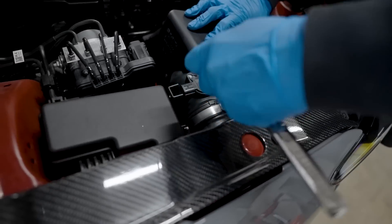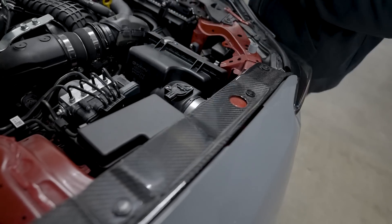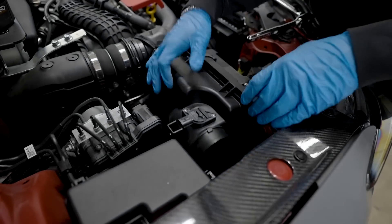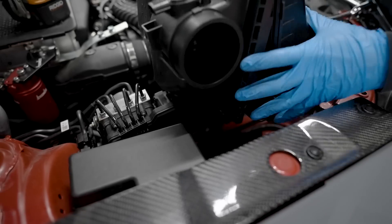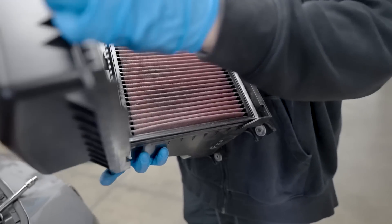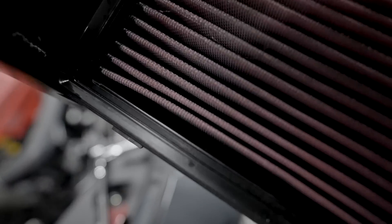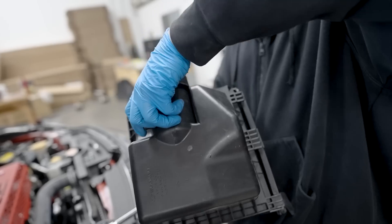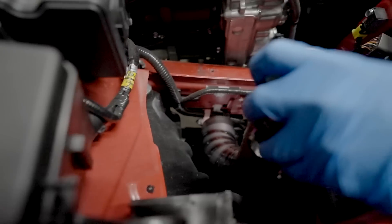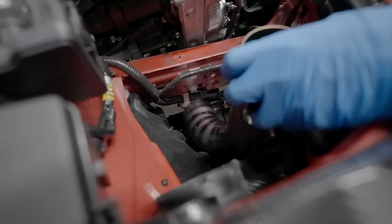Go ahead and take off the airbox with the eight millimeter. I'm gonna loosen up this clamp right here. Here is the airbox. I do have a pretty much brand new K&N air filter we bought 3,000 miles ago — if you all want this, comment below and I'll give it to you guys. I'm gonna have no use for it. So the stock filter just goes up like this, and the coupler connects to the turbo, then you put the filter on top — it's gonna sit just like this.